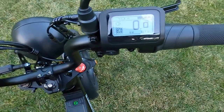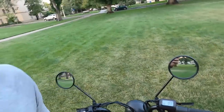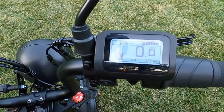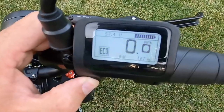The display readouts are the same as on any Juiced bike — Juiced has a fantastic video on their YouTube channel where Torah, founder and CEO, walks through all the display settings in detail, so I'll just gloss over it here. You get speed readout on the right, battery meter on top with 9 bars showing actual remaining capacity rather than fluctuating voltage, current battery voltage on the top left, and an odometer — I've put 127 miles on this one.